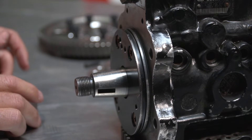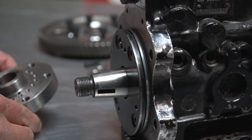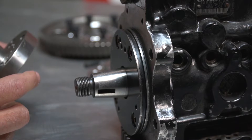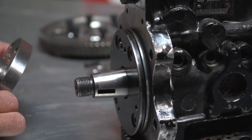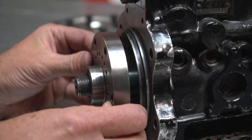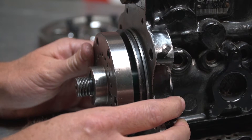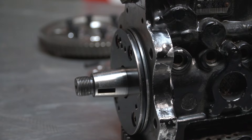One of my biggest complaints with this gear is the fitment of the hub to the shaft. I don't know who originally designed this gear and hub assembly, but I know it's been copied many times by many different companies. The taper bore in the hub is actually not correct to the taper of the shaft. I'm not sure if they just measured it and figured it's close enough, but you can see this guy actually has movement here — you should not be able to push this on and have movement. It's a little bit wider than the shaft so it only touches in the very middle. You can cram it on there, but it's not correct. We actually looked up the right specs and found this is indeed incorrect.